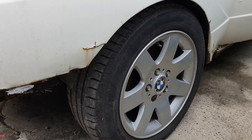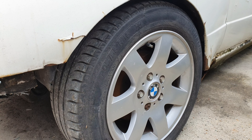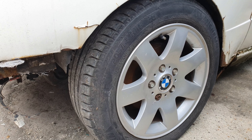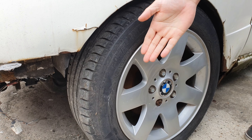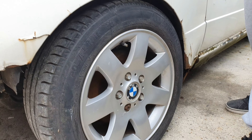It's also got a five-lug conversion — E36 hubs all the way around, front and back. Obviously we need to get caster correction because this front wheel sits too far back — caster correction pushes the wheel forward a bit so it lines up nicely, and when you turn it, it doesn't hit into the car. Look at that rust on the wing — bloody hell!